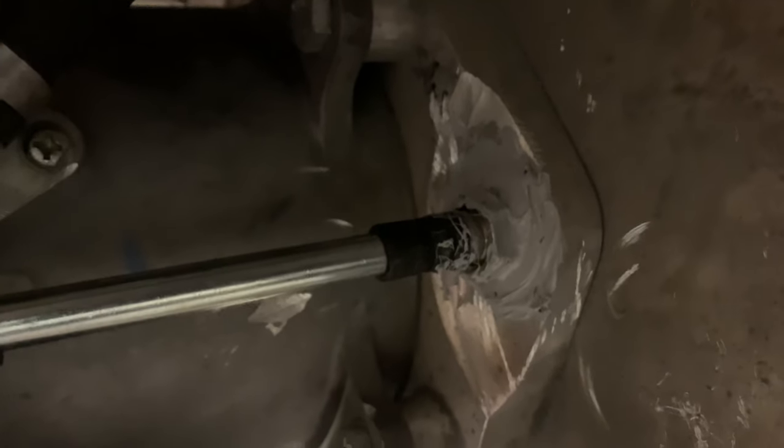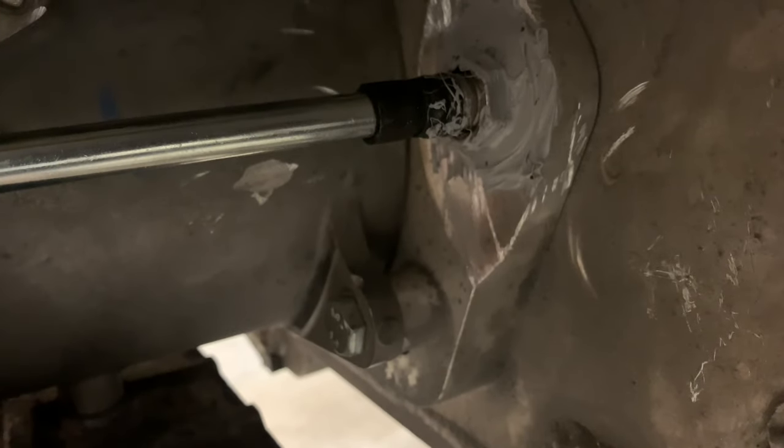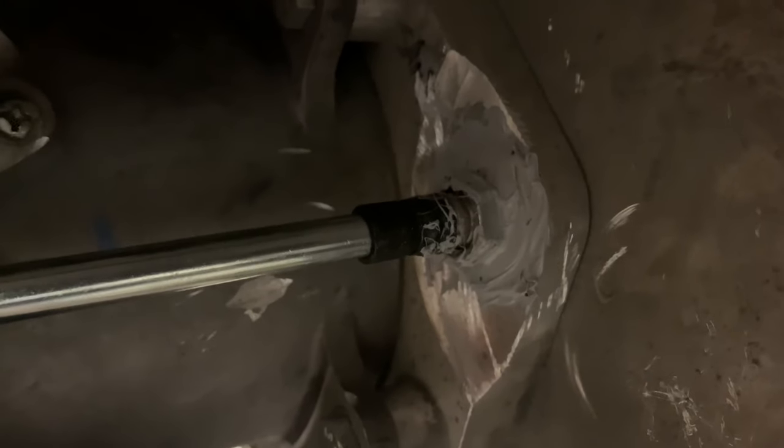Should probably blend that in a little bit better, but we had to notch the Minijet adapter here because of the depth of the steering cable through here. There wasn't enough threads because there's only threads for an inch and a half, and the adapter plus this is an inch and a quarter, so you end up with a tiny amount of threads on each side if you don't use washers, but you have to use washers, so then you basically have no threads. So that's all together. So this goes like so, and I gotta zip tie that scrunchie, but that's all together.